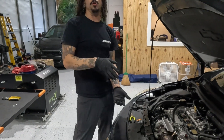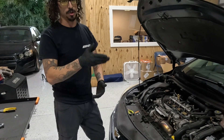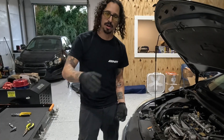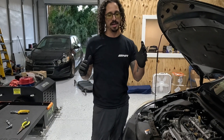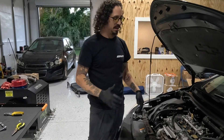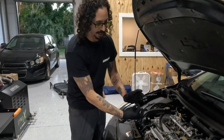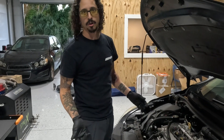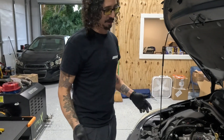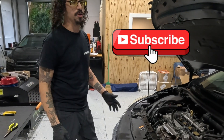From this point, if you have our tune, you can plug up your autoscanner to the vehicle and do live data. I would suggest checking it out while you're driving or do a data log and look at where your desired boost is at, making sure your actual boost is right where it should be at desired. If it's under, I suggest taking the pin off and giving the turnbuckle one more turn or so. If it's over-boosting, you're going to want to loosen it about a half a turn and then go from there, messing with it until you dial it in exactly where you like it.